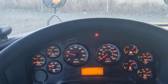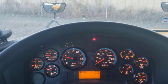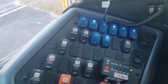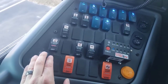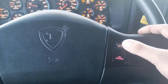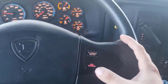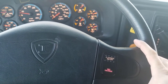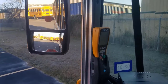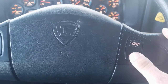Now they're walking to the back — you're going to do the same order again. Your headlights are already on, so your clearance lights up top are on. You're going to turn on your strobe light and also turn on that master flasher switch again. You're going to do your amber warning lights — you'll get a thumbs up. Then you do your reds or your student loading lights. You'll see them in your mirrors and you'll see the examiner back there giving you a thumbs up. Then just turn those back off.